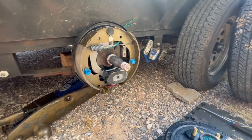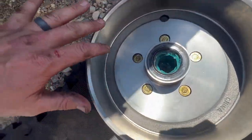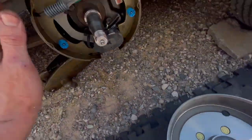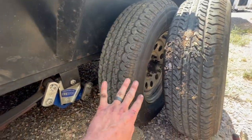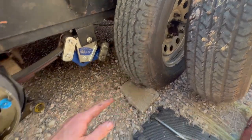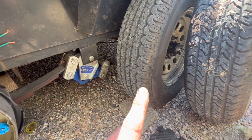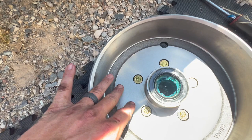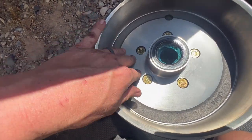I was cleaning the grease off the seal — just want to make sure we don't contaminate the brake shoes. One thing I noticed is this back brake doesn't lock anymore; we're going to throw a whole new set of backing plates on it. I'm wondering if it's the magnet surface, because my drum surface isn't nearly as flat as this one.